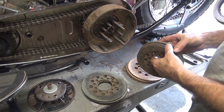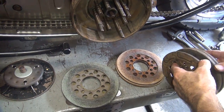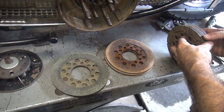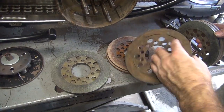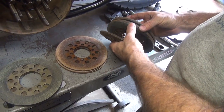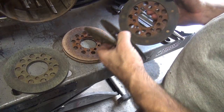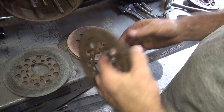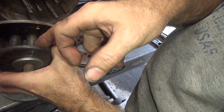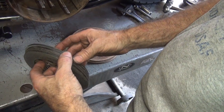We've got to find some clutches. Now here's the clutches that you had, Dan. You had one of these plates — I think it was a green one. You got these stock thick-ass steel ones in here. So you had a three-plate clutch, which is supposed to be three big fat ones and then a half plate. Okay, so I need one fat one and that's it — which you don't have. You only have two fat ones. See the difference between these two? That's the stock system. Now what we're going to do is shit-can these in this half plate. These springs here are the late '68-and-up style spring that takes four plates. We're going to go to a five-plate system, which works better anyway.